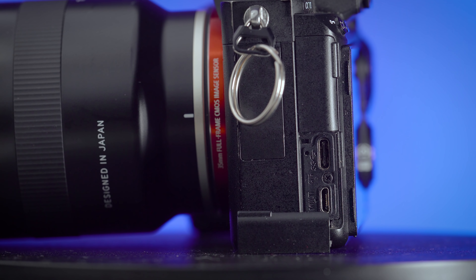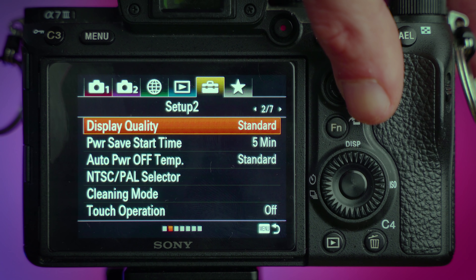Generally, I've found that if I pull the screen away from the camera to let some heat escape, and plug in a USB power supply — either a power bank or mains — to take some strain off the battery, the camera runs cool enough that it doesn't cut out. It does sometimes show a temperature warning, but that's at the standard setting, which you can increase. And granted, I live in the UK where double-digit temperatures feel like summer, so if you live in a warmer climate you may have more trouble.